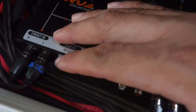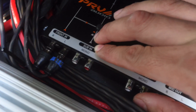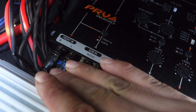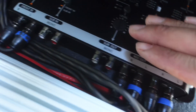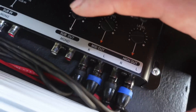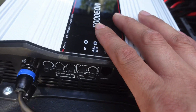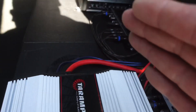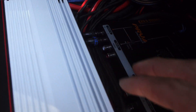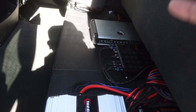Using my PRV crossover as an example — you just need to connect the front end and your sub end. I actually ran my sub input directly to the bass doubler. From the EQ front out, you can see a high out and a mid out on the crossover. After the crossover, those RCAs go directly into the amps. The rear amp gets the rear signal — bam, it's connected and ready to be adjusted. If you have another amp for mids and highs, run that RCA to that amp. Sub out goes into your sub amp. Now you've got signal ready to rock and roll — then you just have to worry about your power wiring.